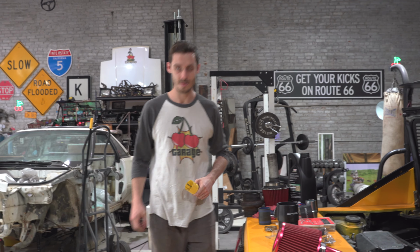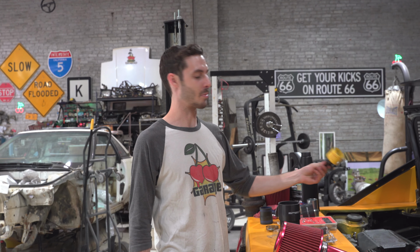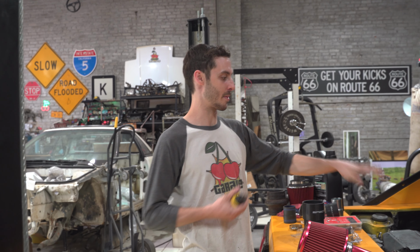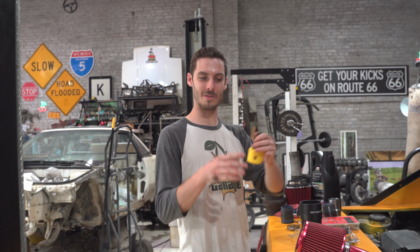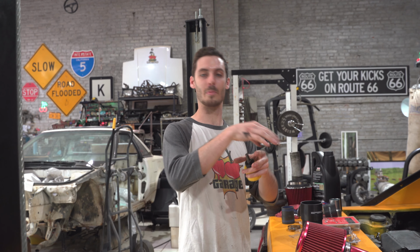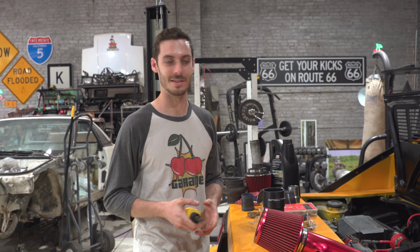What's up, guys? Back. We got a 2 1/4 inch hole saw. We're gonna approximately locate where this is gonna be on the hood, drill through it. Of course, we're gonna tape off the inlet to the turbo first. And then drill through it, and whatever offset that we have, we're just gonna grind it and open it up to 3 inches overall. At least 3 inches. Maybe 3 1/4 inch, 3 1/2 inch. Yeah, you can just watch us do it.